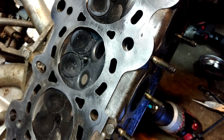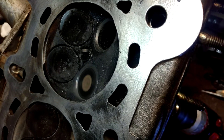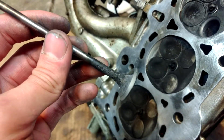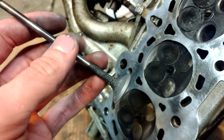I got the valve to the rough shape of what I needed, stuck it in, put some valve grinding compound on it, hooked it up to a drill — the drill is attached to the valve stem — and I'm just going to town on it letting the valve grinding compound take care of the high and low spots on that valve. Fingers crossed this thing actually works. It looks cleaned up enough to me. There's one little low spot but I think it has contact at that point so I think it'll be fine.